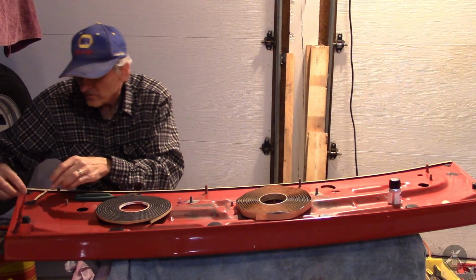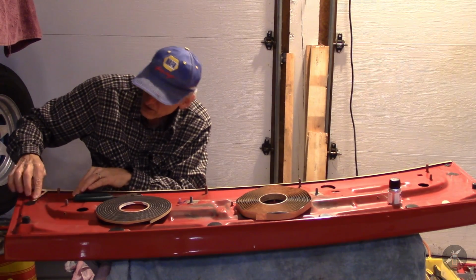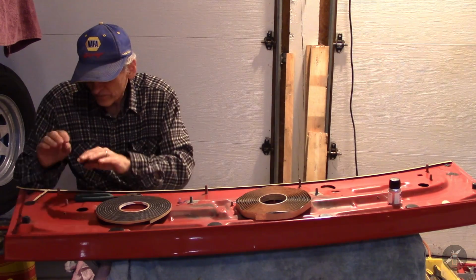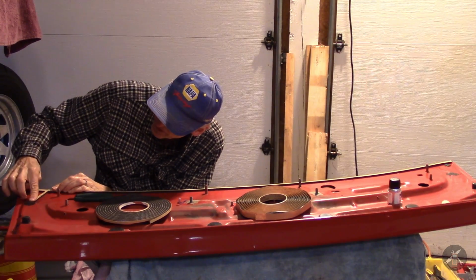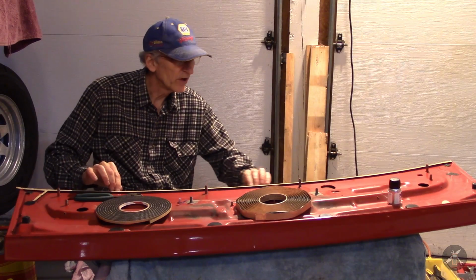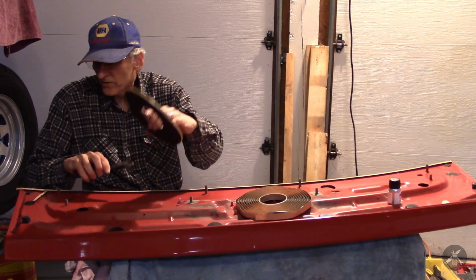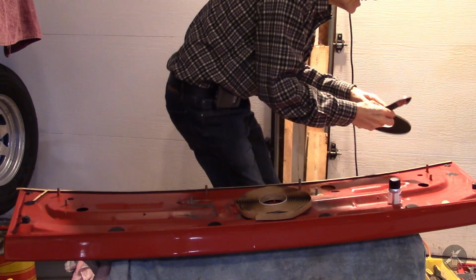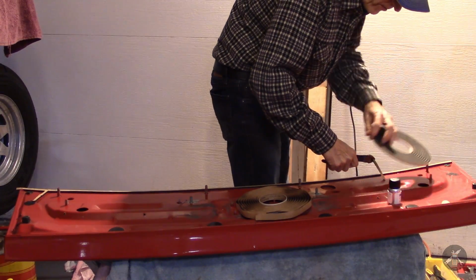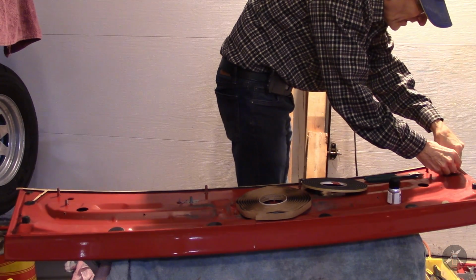Sometimes you use these kinds of strips to hold down wind noise, and sometimes you use them as, I'll call it, a backup, so that when the butyl crushes, it doesn't push out, it pushes back the other way. It can sometimes be just for positioning, and maybe it gives you a nicer edge when you don't see the edge of the butyl. Can't tell for sure. We'll put a piece on both ends. It does intrude into the area where they want urethane to go, but I think it all blends together in the end.